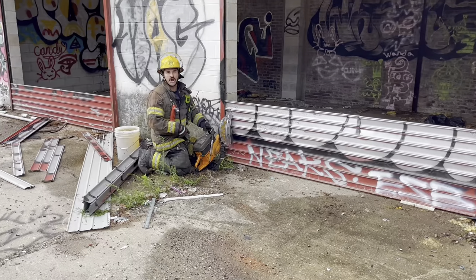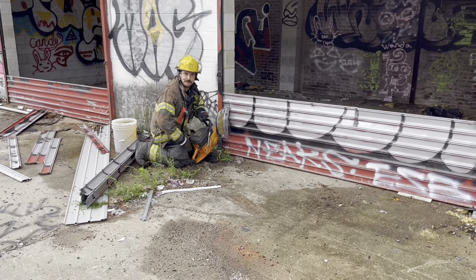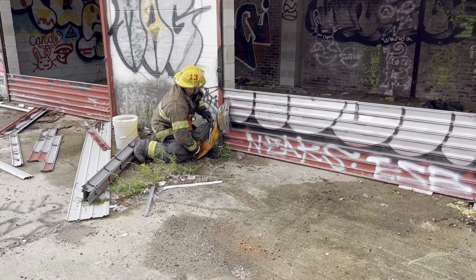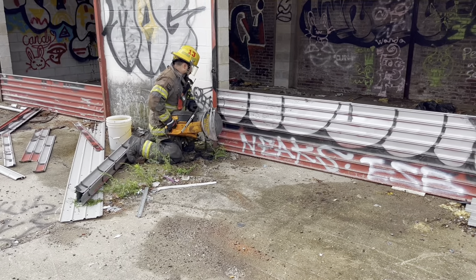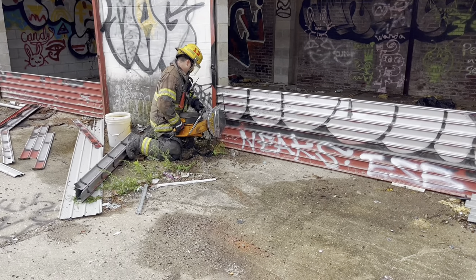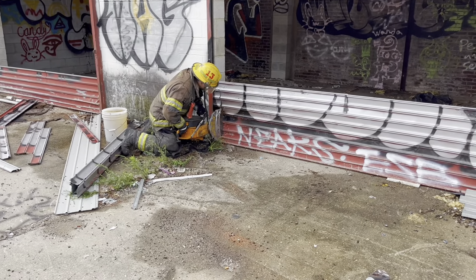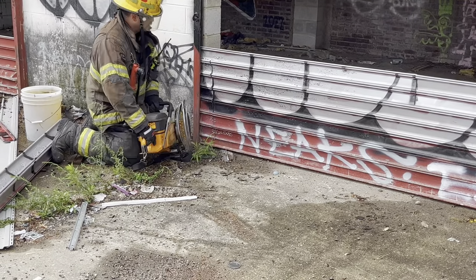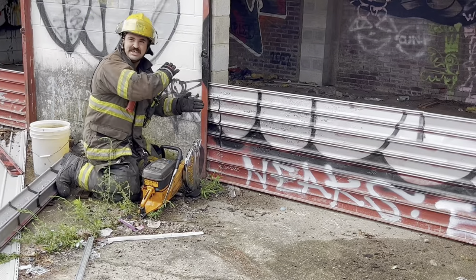The triangle cut is the only tricky bit of the barn door technique. Video clips for the barn door technique come from Instructor 5 Productions — I saw their video well over a decade ago and the technique has served me very well ever since. My guard is getting in the way, but if my blade is in there, I can just push into the door and lift up on the handle or shove the guard. Now I'm all the way down to that angle iron.